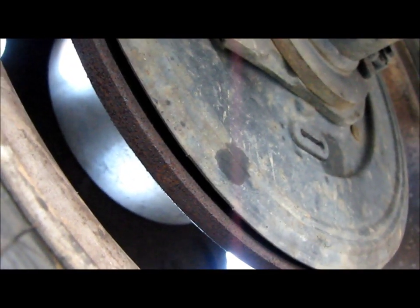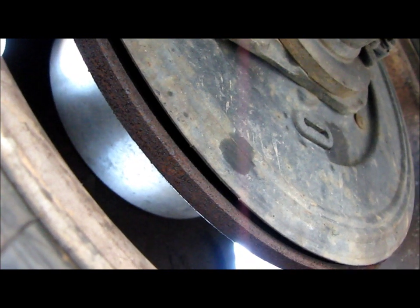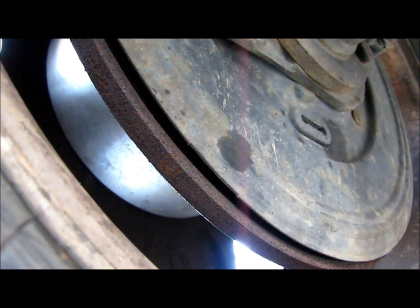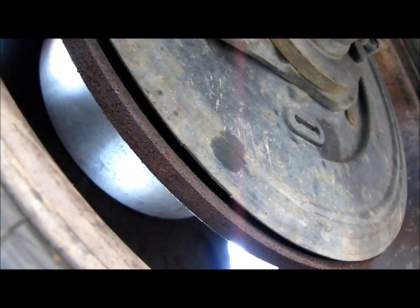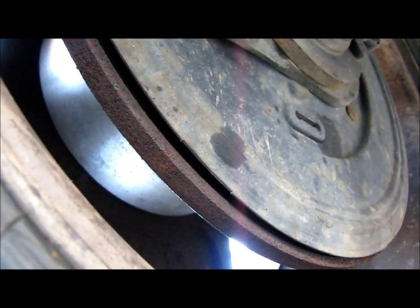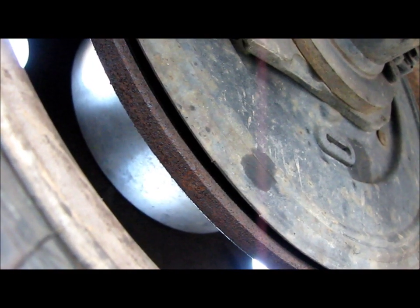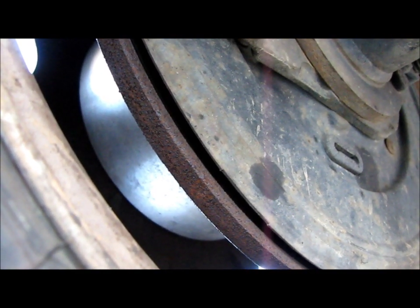And it's an aluminum spacer. You can get it on eBay. Basically it has holes drilled in it that you just bolt to the truck. You take the wheel off, and you just bolt the spacer to the truck, and then the spacer has its own studs, and that's what you bolt the wheel to. And I haven't had problems balancing or anything with these.